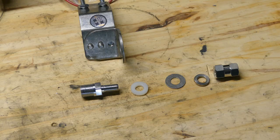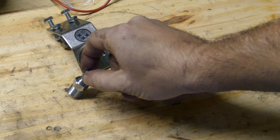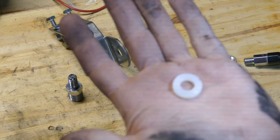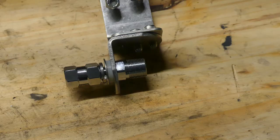In order to mount the antenna correctly, there's a particular order to these parts. First, start with the cable end — that'll go through the bracket first. Then this nylon washer that has a step on it so it centers and isolates the antenna. Then the washer, lock washer, and antenna union thread — the antenna will thread here. The nylon washer has a raised edge on one side that needs to go through the hole on the bracket. Make sure it's nice and tight so your antenna doesn't fall off.